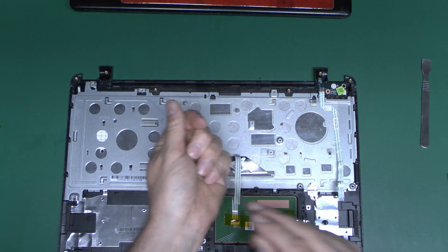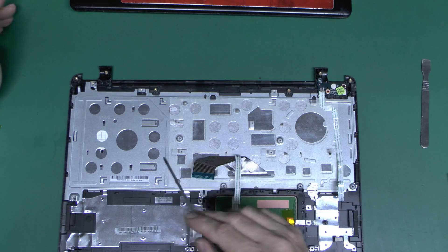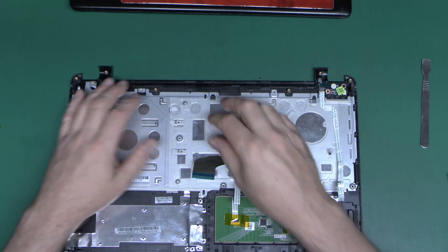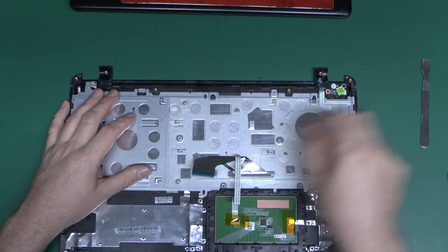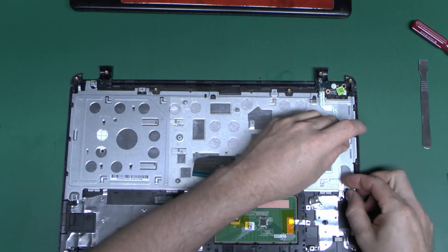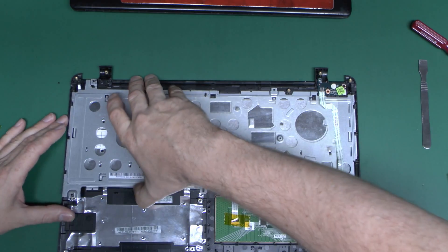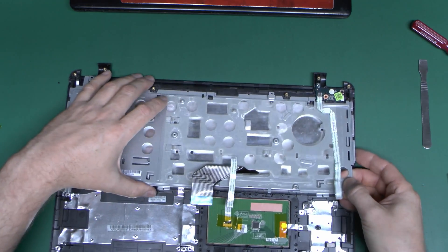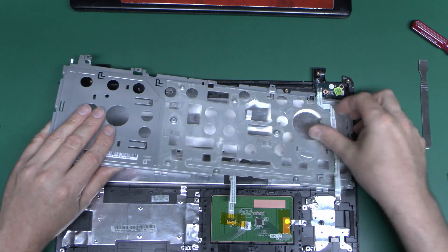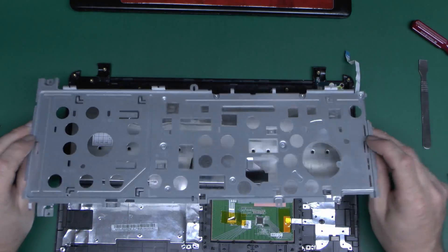There are also two sizes: the black ones there and the shiny silver ones, which are even smaller than the black. Fortunately the metal plate has the actual sizes marked on it for where the silver ones go — M1.4 by 2 — so at least that's something. All of these have little plastic pieces over them to stop the screw head shorting out onto the board below, except for the ones with that yellow tape over them. Once the screws are removed, this plate needs to be taken out — it's a sliding arrangement, so we need to ease it in one direction, peel off these pieces, and the whole thing should lift off. There we go — that's just the support plate for the back of the keyboard, so we'll keep that of course.